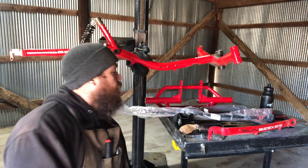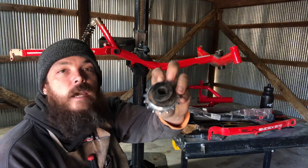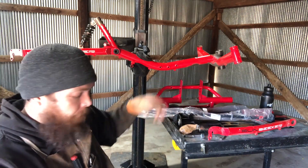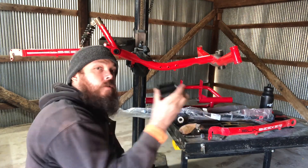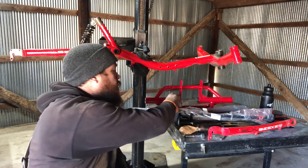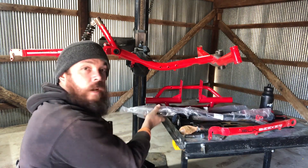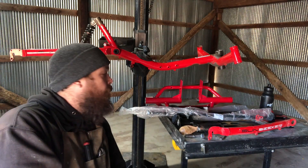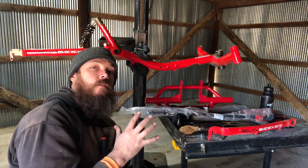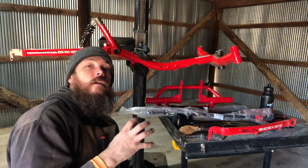This drive system connects them so you get an axle for both sides, two sprockets, and also the adapter piece which allows you to connect your freewheel to the axle itself - which is about 15 millimeters. So that's two rims, two hubs, and of course the spokes to connect them. If you want to buy the differential you'll need the differential plus freewheels, and your axles - either one axle for single drive or two axles for double drive. If you're getting the positraction you also have to think about braking. In this system we're building today it'll have a single rear disc brake, but if you put in that differential system you'll have one side that spins freely and the other side that locks.